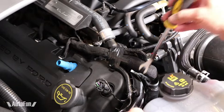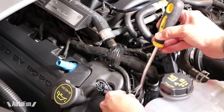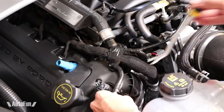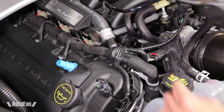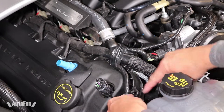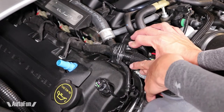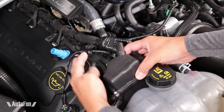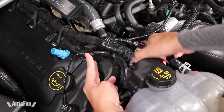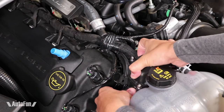This harness clip must be gently released. I use a special tool meant for body clips, but pliers work just as well. These two clips will secure the oil separator in place — one clip goes here, and the other here. To avoid losing any clips in the process of mounting the unit, I first line up the separator, and then I insert the clips.